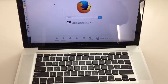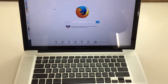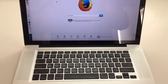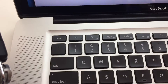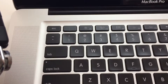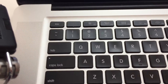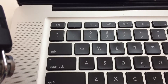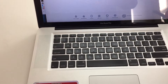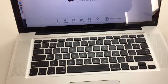This is my early 2011 MacBook Pro 15-inch, and today I'm going to replace the fans in it. To give you an idea of why — there's kind of a little knocking hum. It gets worse when the computer's under load, like if I'm rendering video. I've tried cleaning the fans. I even took them apart and lubricated the spindle on the fan, and it just didn't seem to help.